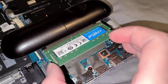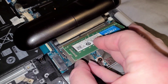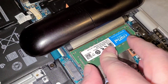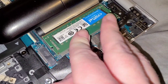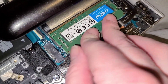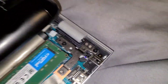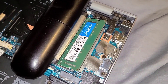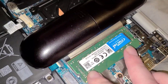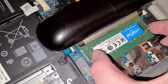So once again, I'm going to take my RAM. The slot can only go in one way — as you can see, the slot doesn't line up with the tab the other way. I'm going to slide it in and carefully make sure it's in even on both sides, then push it down until she snaps into place. And that she did.